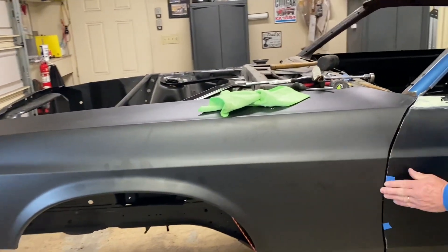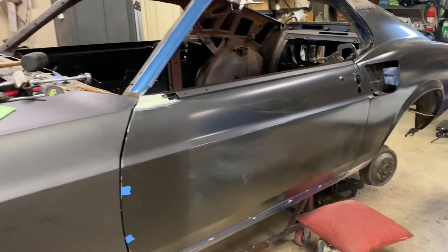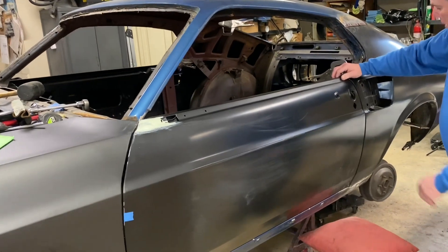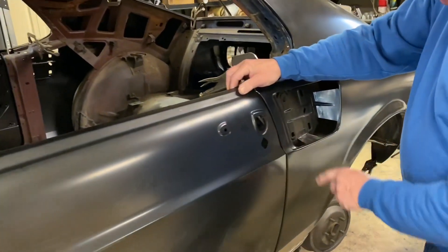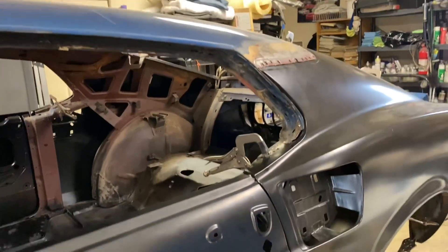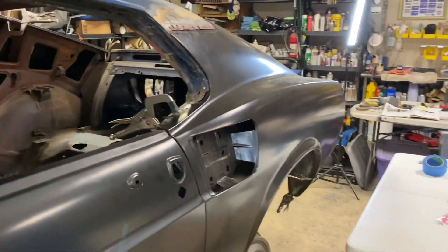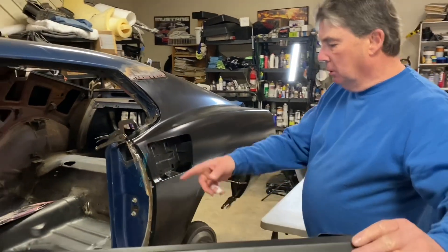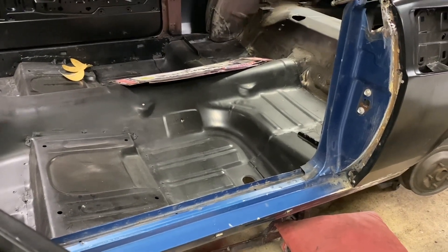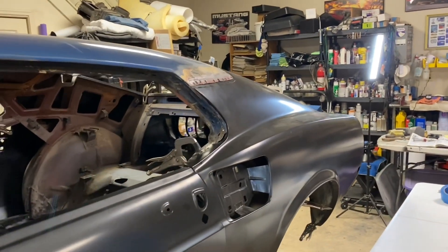Got the front fender on, it tends to work out. The gap looks good but I've got some level issues right here that I'm going to be working on. I got the door on the other side; I don't have the other fender on. This will let me get the gap right here on the rear quarter, and when I get it like I want it, I can go ahead and start welding this in and it's pretty much done. Then I pull the doors off, clean up the A-pillars both sides, get the threshold ready, strip it down. Then I can move on to the rest of the car — we'll get the fenders welded in.